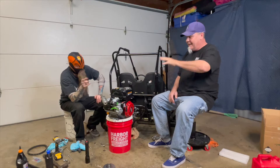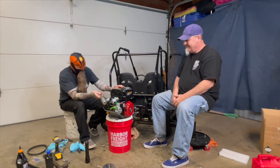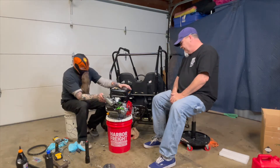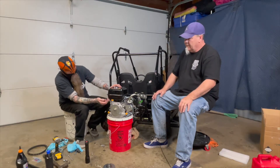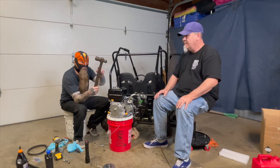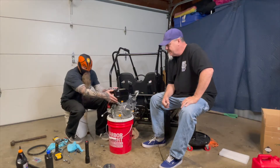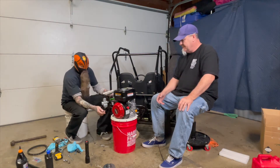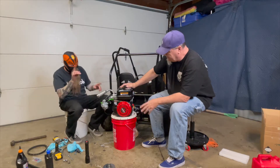Looch went ahead and changed out everything on the motor. We had to modify the tank a little bit to get it on the new engine — you will have to cut off the little top part of your oil fill on this one to make it fit. We changed the wiring harness in the back and put it to the same plug so it will just plug in for the kill switch — it may work, it may not, we'll have to tinker with it. We also had to clock our pull start because it was way over in the back and we just couldn't get to it with the seat, so we moved it to a better position.